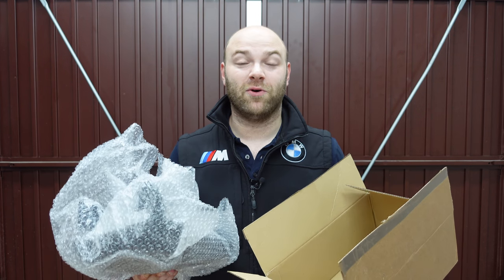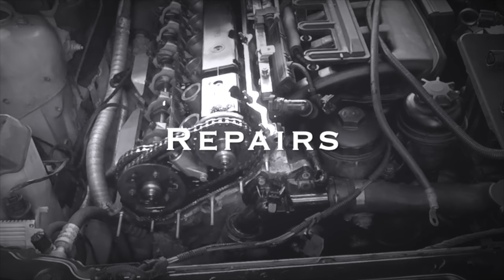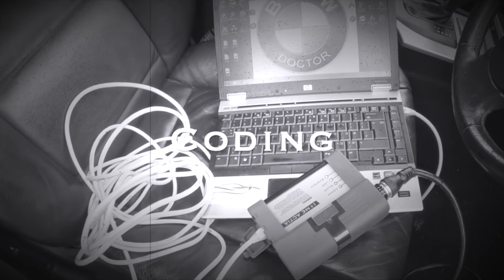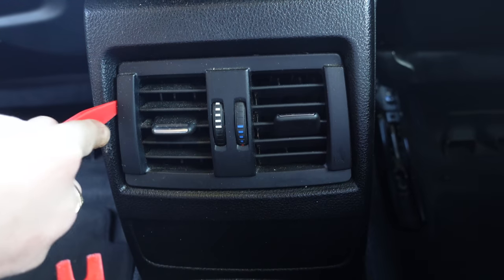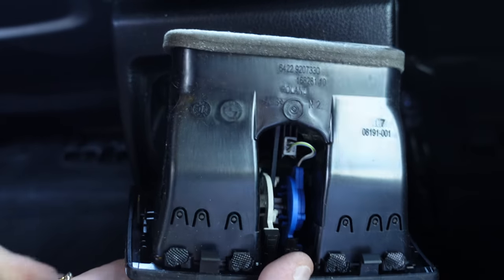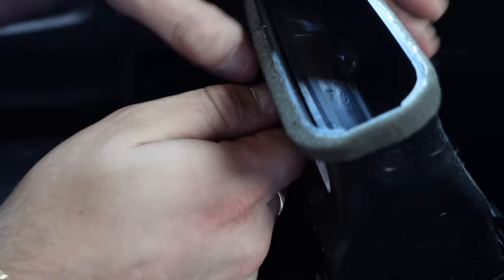Let's go out to the car and I'll show you how to remove the armrest on your BMW F-Series. The first thing you're going to want to do is pry out the air vent right here, just like that. Then you'll get that straight out, and you will have a connector on the back which you're going to want to pull off and disconnect, as you'll see. Now we've got that disconnected.